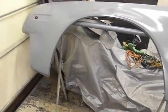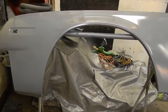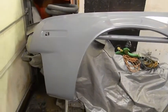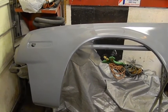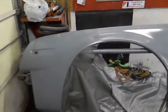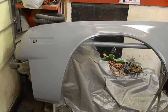The garage is not ready for paint by any means, not even for this, but the gun's good. I want to test the product — I never used this before. It seems to be doing pretty well, staying at a decent steady sheen with the second coat. The stuff I used on the wagon, even after the second coat you could still see where the spot primer was, the sheen difference. That's the way filler and primer is — it gets absorbed, and you're hoping the next coat acts as a shield so it doesn't go further. That's the whole purpose of sealing it, so it doesn't suck the gloss out like chalk.